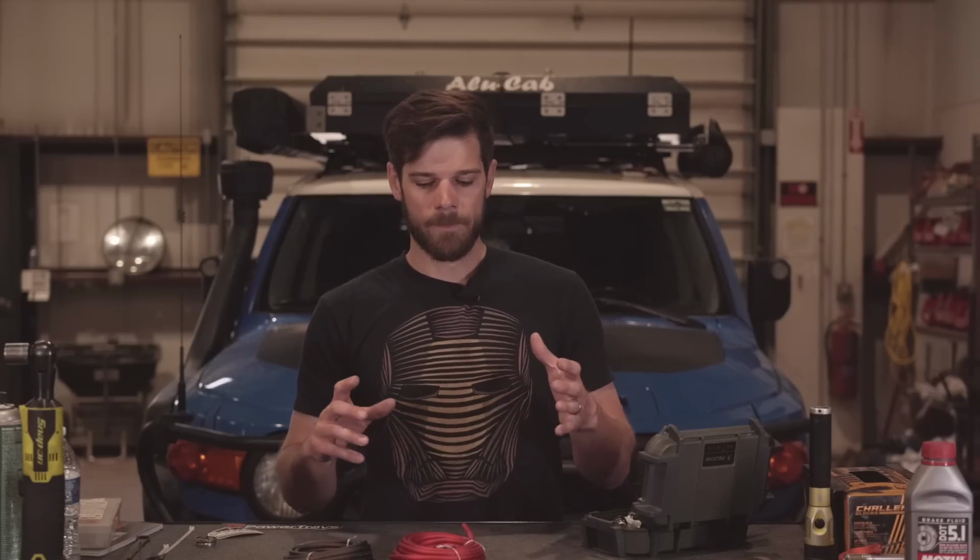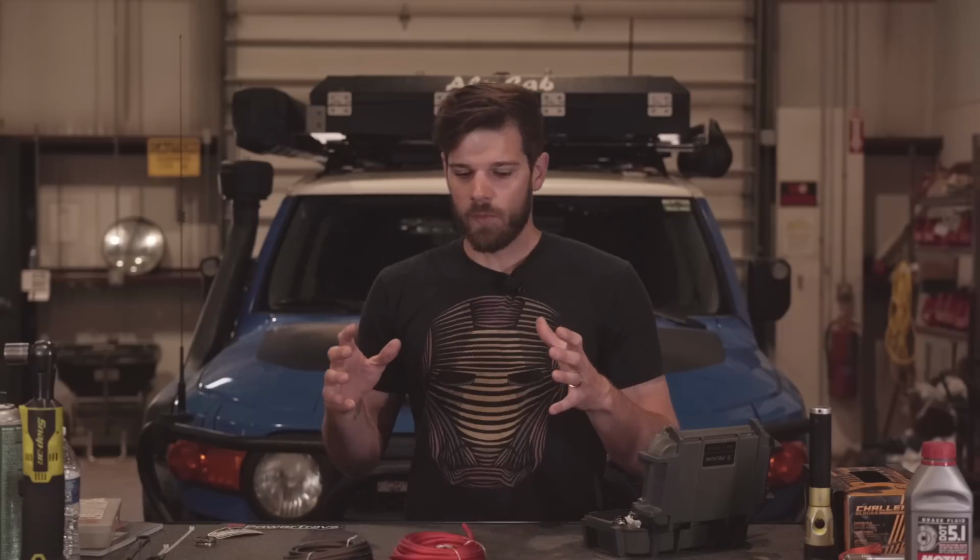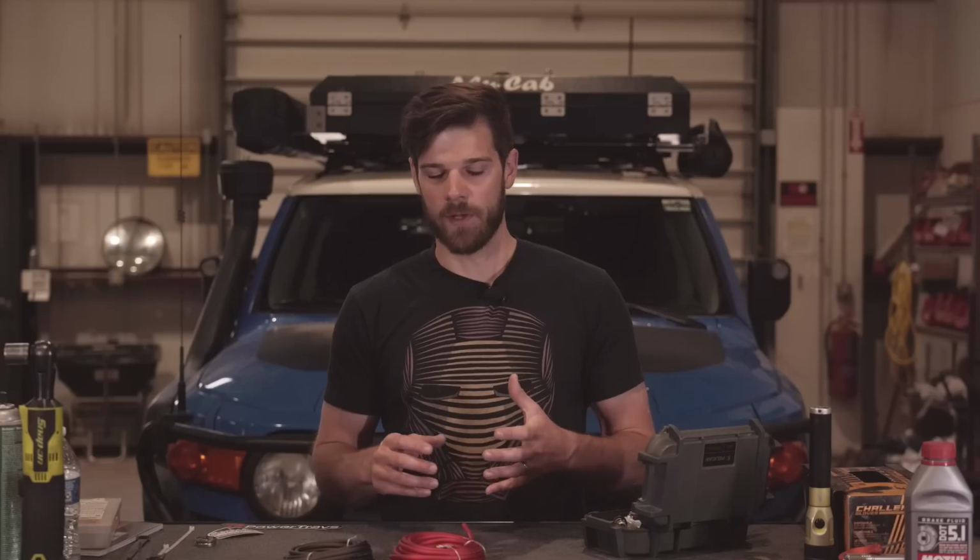Most refrigerators, ARB, Snowmaster, National Luna, they all have an auto low voltage disconnect. So what that does is it protects your battery and it protects you from not being able to start your truck the next morning. You'll see major voltage drops out of an AGM right away. When you're down to like 75%, you're gonna see that thing at probably 11.7 volts or something.